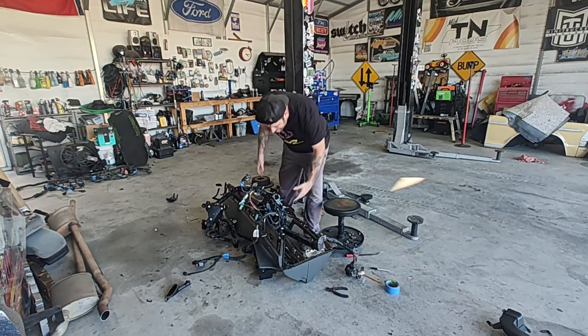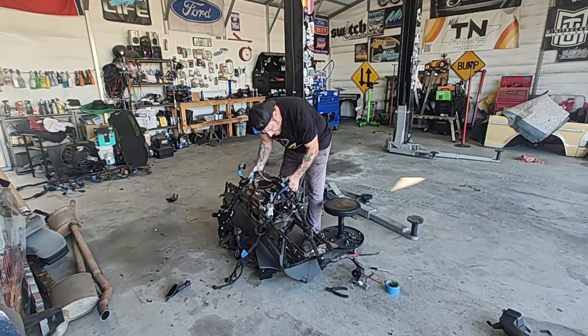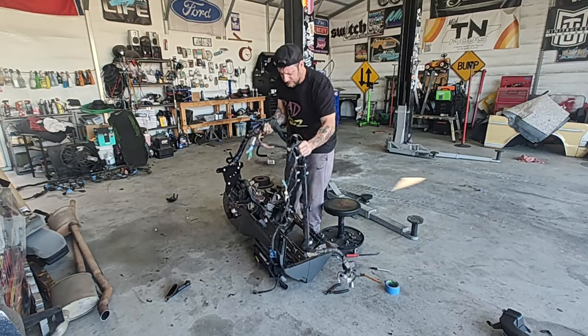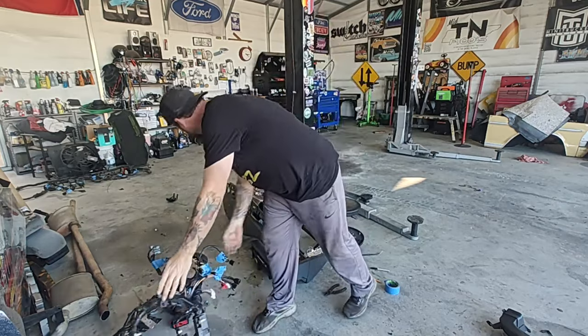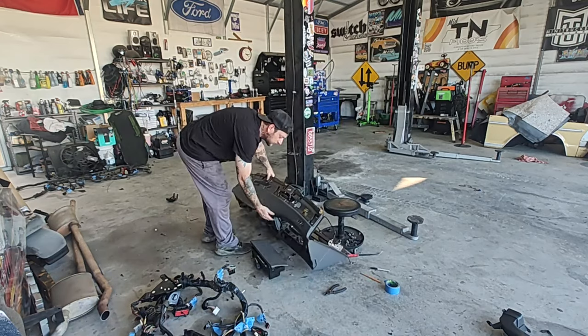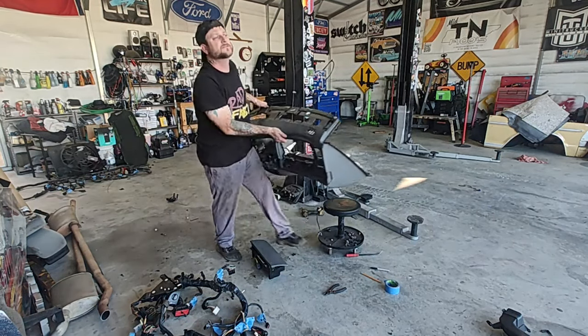There's a whole bunch of stuff we've got to get out of the way first to get to this wiring — it's behind all this ducting and some other stuff. I use a 7mm for this, might not be the exact size but a 7mm fits it. We'll zip all these out — make sure we don't drop all these little screws into the driveway or I'll leaf blow them out there and flatten all my tires. I think we've got everything detached. We'll try to wiggle everything out. Okay, we're done with this dash now.